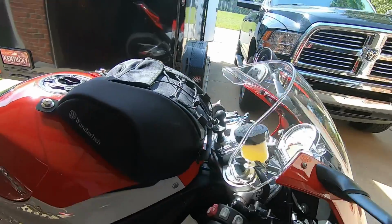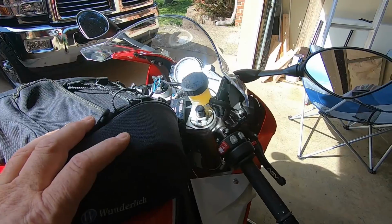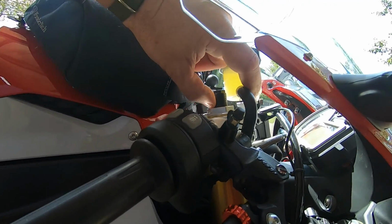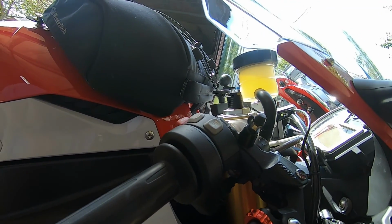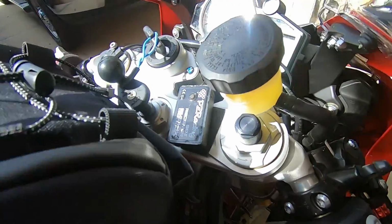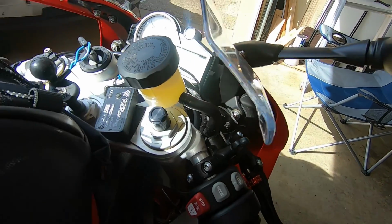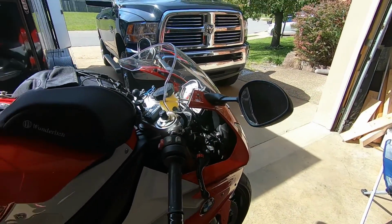While I was finishing up, I looked at this brake reservoir, and it just didn't look like it was straight. I'm anal, but it would all have been okay. That little plastic retaining clip there is kind of broke, and I tried to straighten it up and it still didn't do it, and it broke. So I've ordered a new reservoir, but the biggest thing was, you can't even see it on this thing, but this hose is actually cut right here. So I've got a few more. Ordered a new brake reservoir, hose, and now I have to get a clip-on.